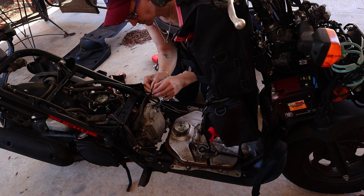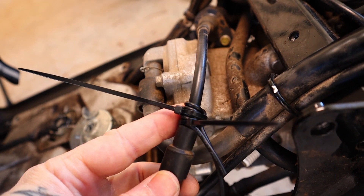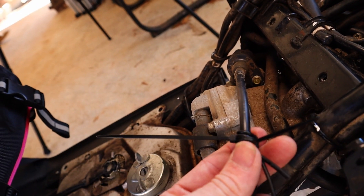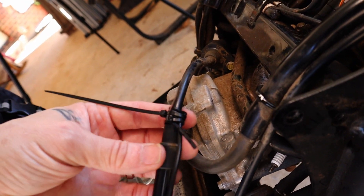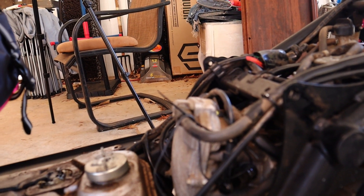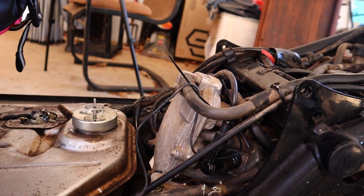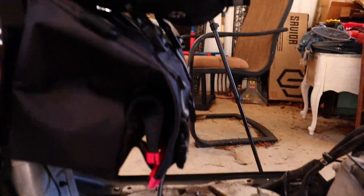You can see it's wrapped around the spark plug wire four times — four full wraps — and then I've got this zip tie holding the beginning and this zip tie holding the end. That is the spark plug wire right here. In a perfect world you'd probably tape this wire down all the way around, but it doesn't exactly need it because this floorboard is just going to go on top and it'll sit right here in this little channel.